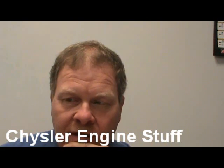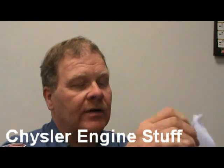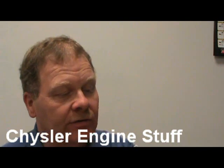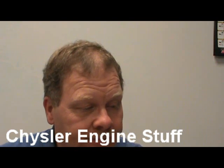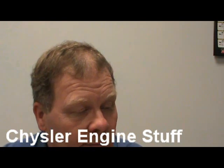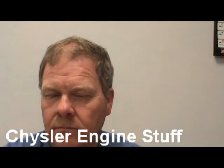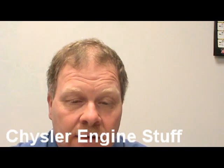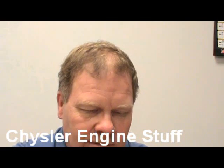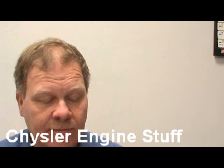Now then, I'm going to tell you about your answers here. Somebody read the first question for me. I can read the first question if somebody wants to. On the 2.7 liter engine, you need to apply sealant where? Where the oil pan and timing cover gasket meet. Okay, that's up there. Where you're most likely to have a little oil seepage, you want to combat that.